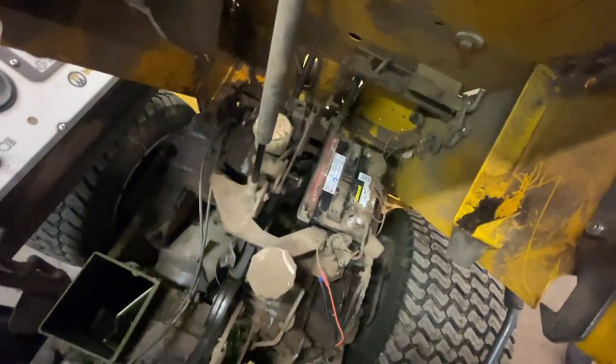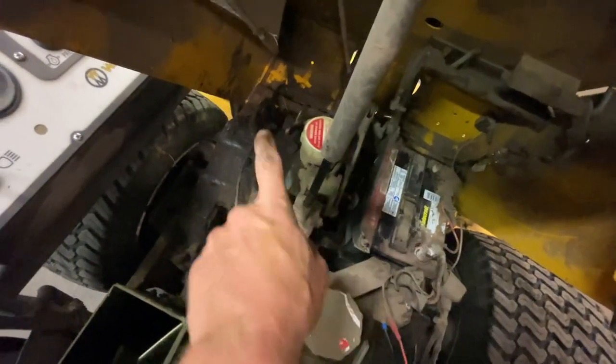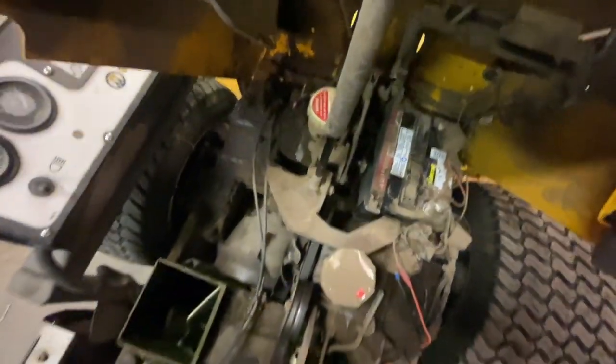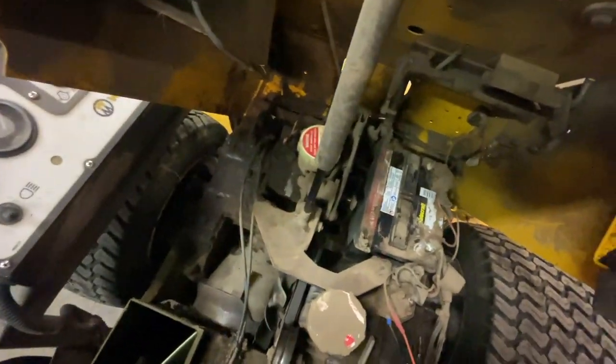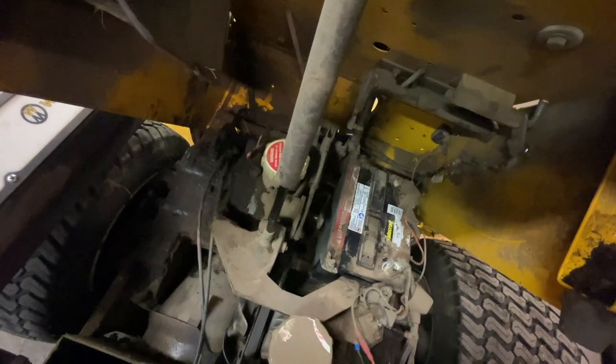That's a little better. Used the vacuum to get rid of the majority of the grass. You'll notice my gearbox is wet — I replaced the O-rings on the parking brake pawl, but for whatever reason the O-rings I put in must not have been the right size. It's been slowly weeping a little gearbox fluid. These gearboxes are very slow-speed rotating units — it takes pretty much a bag of rocks to blow one. As long as you don't run it completely out of fluid, they're tough. I'll get the proper O-rings and seal it back up.